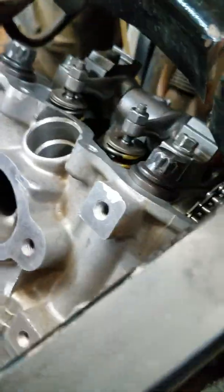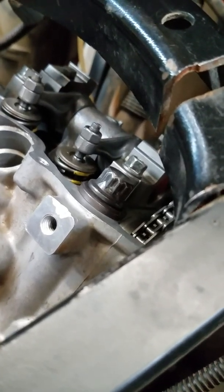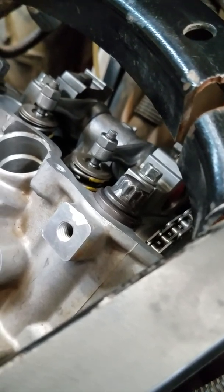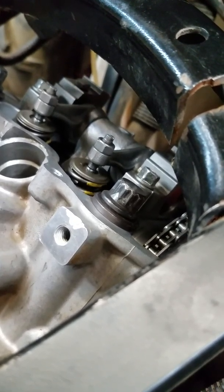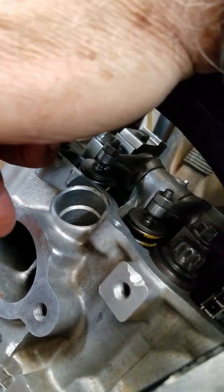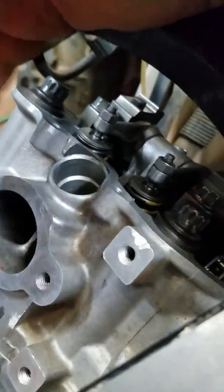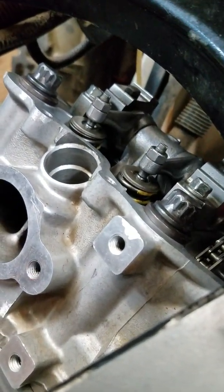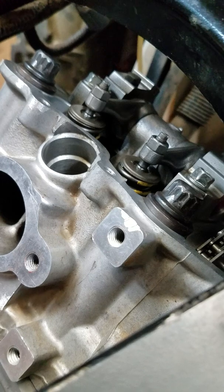The cutters don't cost much. Many times the seats are fine and the valves are just dead. Don't be afraid to put new valves and always new seals in yourself with the head off the machine. Put those intake ports straight up and pour your naphtha — your parts cleaner — in there. If it doesn't run out past the valves, you're good. Cutting valves or valve seats is a science all of its own that I've never really worried about. I just make them right.